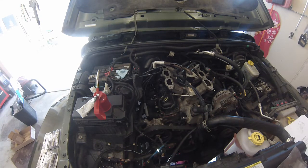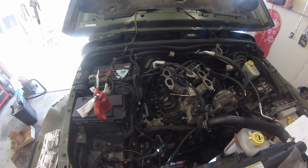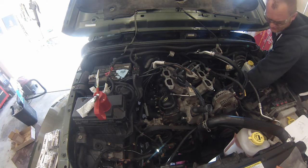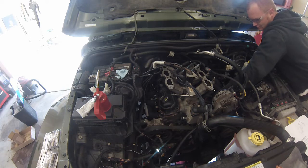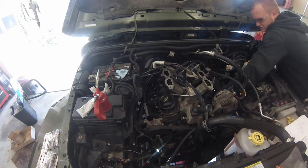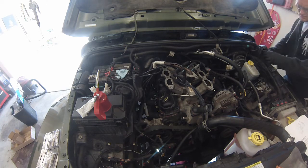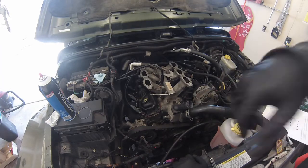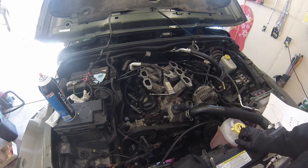We've got the exhaust hooked up. Next step, I'm going to go ahead and put the spark plugs in. I don't have the torque spec on me at the moment, but it's something like 23 foot-pounds, I think. It's not very much — not a whole lot more than just taking a wrench and snugging it up. Once you have all six of them in, we'll pick up with starting to put the upper intake on. We've got our spark plugs in and I went ahead and connected the spark plug boots to them just to keep any dirt off of them.